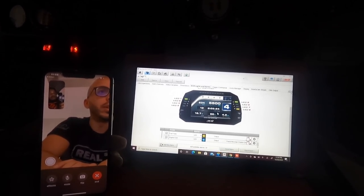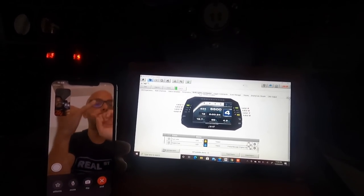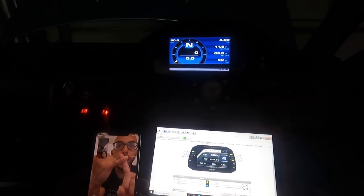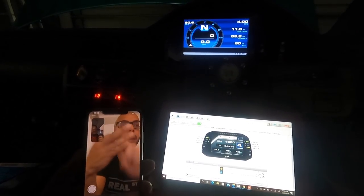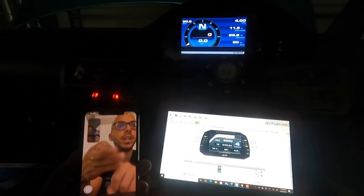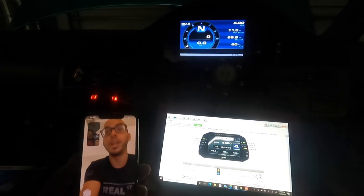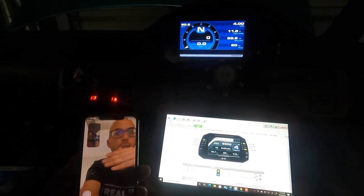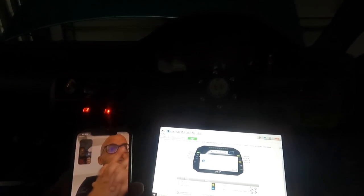So we're gonna go ahead and click transmit. Right now we're transmitting a cold warning. Then we're gonna do an engine warm warning, and then an engine overheating warning, and then I got the shift lights activated, so right around idle, your shift lights should go crazy because I got it at every 100 RPM from 1,000. So it should be fun to see everything light up.